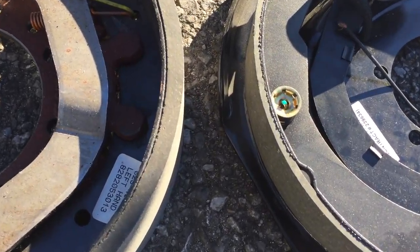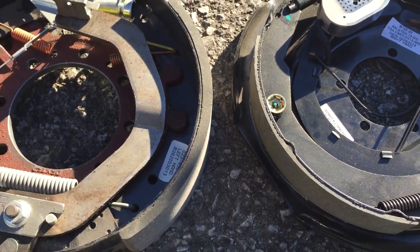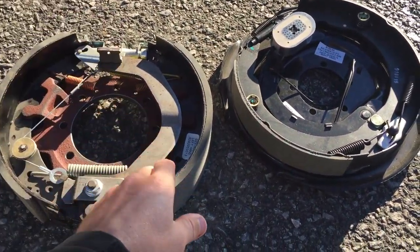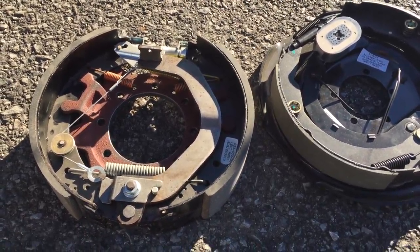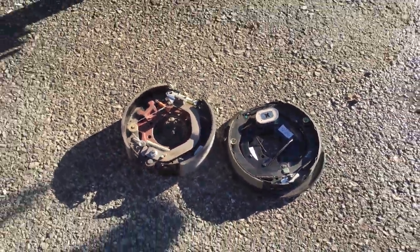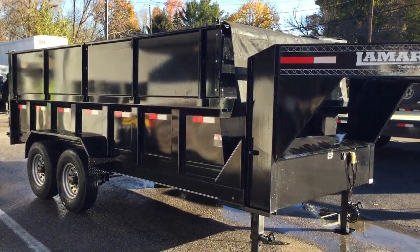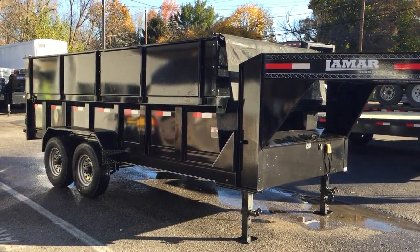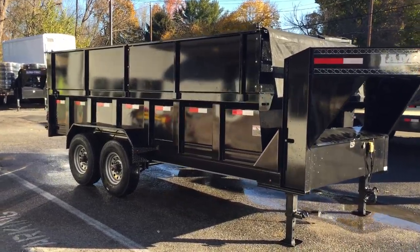The pad thickness on the 8k assembly is about three times thicker and you get a much more powerful magnet. The 8k brake assembly is the same assembly that goes on a dual tandem — so for those thinking a dual tandem dump gives more braking power, you're actually wrong. The empty trailer weighs more, so an 8k axle in an electric setup gives you the maximum braking capacity.